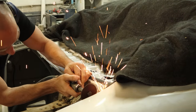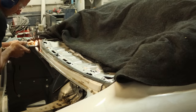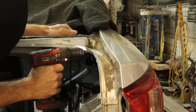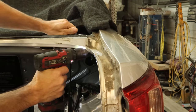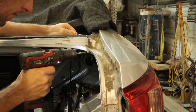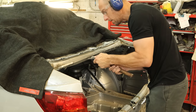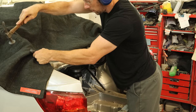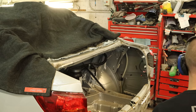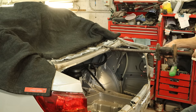Now we're going to start grinding out all of our spot welds. We're just going to go ahead and use our die grinder and a die grinding disc — just to mess with all the belt sander advocates out there. But I am using hearing protection and eye protection, so take your wins where you can get them. There's a couple of spot welds that we need to drill all the way through, so we're going to drill them with our eighth-inch bit first and then go back over them with our 5/16 — actually a little bit larger — just to knock that spot weld out of there. Now we can take our makeshift breaker, slide it down this panel, break all these spot welds loose on the back. Then we'll get the two edges and bring in our new spot weld breaker — Big Bertha now identifies as a spot weld breaker. We'll tap there and it's out.